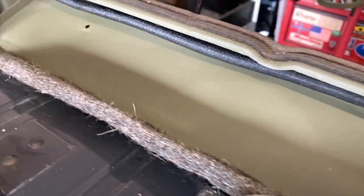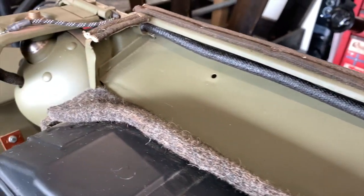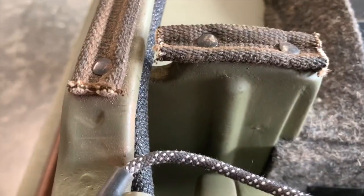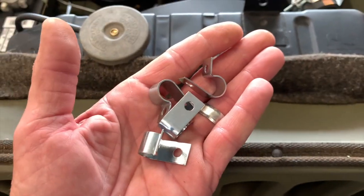Starting at the back side of the headlight bucket on the passenger side, we go through those two little areas I pointed out at the beginning of the video, and then we're going to go in front of the bracket on the opposite side where the driver's side is. We're going to come right underneath the bracket there where it folds up and down, where the headlight bucket is mounted to. If you notice, there's a little clip there on the side of the grille — that's going to be important.